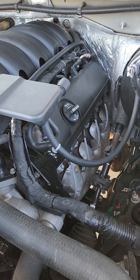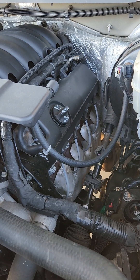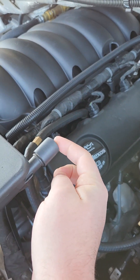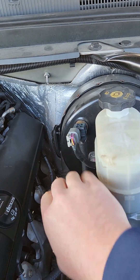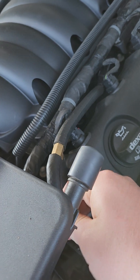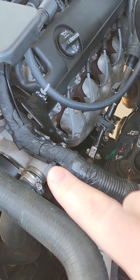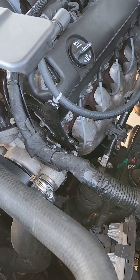I've also had some questions about how this vehicle does not come with the vacuum pump for the brake booster, and people are asking how did we deal with that. What we did is we plugged off the PCV inlet right here. We have the brake booster here, and we got this line right here that goes right up there. We tied into the vacuum that already exists on the engine, and that's what's running our brake booster. So no more belt-driven vacuum pump like you're used to — typically down on the bottom side of the engine — that no longer exists.